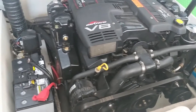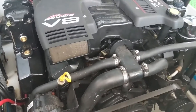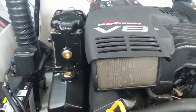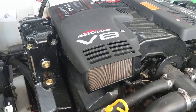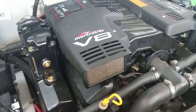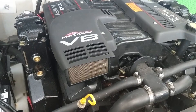Today we're going to be installing a high-performance 4-inch intake kit on this Mercruiser 7.4 MPI engine. The factory intake has a 3.75-inch inlet into the throttle body. We're going to use a reducer to go from 3.75 inch to 4 inch, then attach our 4-inch intake with mandrel bent aluminum piping for smooth flow, and also a K&N flame arrester air filter.